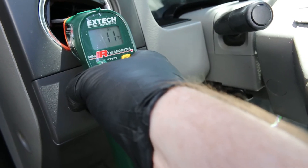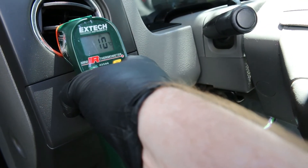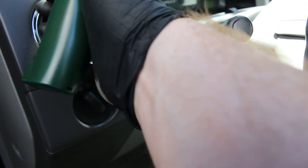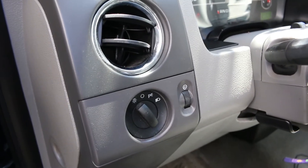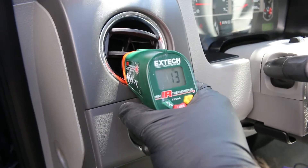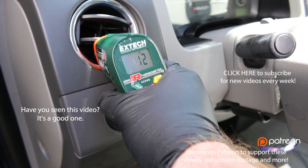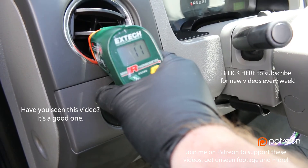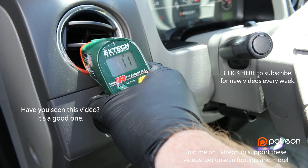If you put too much in you can freeze over the evaporator core or blow off the relief valve, so stick with matching what's on the gauge. We're down to 10°C — that's cold, very very cold. It's just that simple. The refrigerant is about 13 Canadian right now for a pound, regular price, and you can get it under 10 bucks depending on where you buy it. Just that simple — go ahead and fix your vehicle. If you like what I do here, click the thumbs up or support me on Patreon. See you next video, cheers!